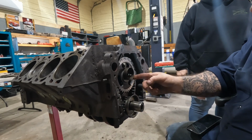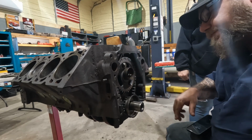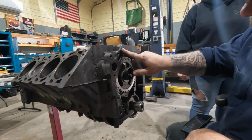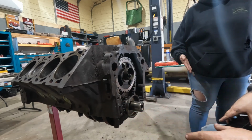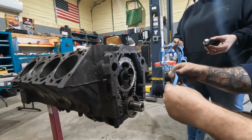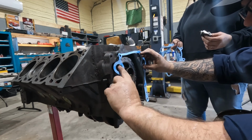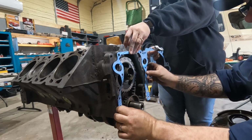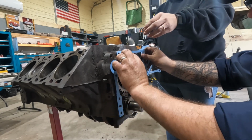This pulley here, or ring here, is offset. This is what drives our fuel pump. Rod goes right through here. So I think we got just a little bit of cleaning up to do here maybe, and we can get the timing cover and the water pump on, if I remember how any of that stuff goes. I think that's backwards. That looks more good.